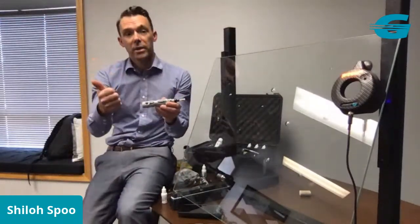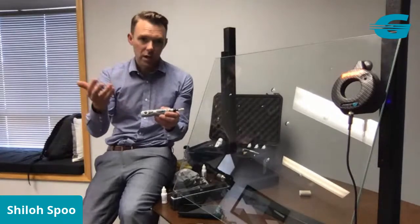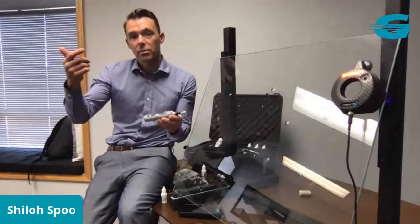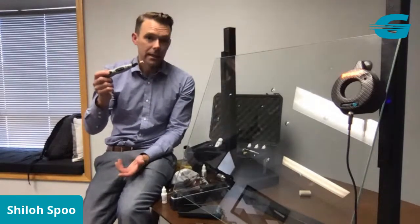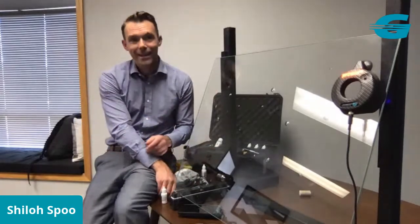Number one, being able to do effective drilling if you choose to drill. If you're doing long cracks, you have to drill. Number two, being able to massage and help fill legs and tight legs, especially on big star breaks or big combos. And number three, being able to polish your pits to a sheen that is basically like glass itself. So that guy's ready to go. I put my stuff back in my kit.